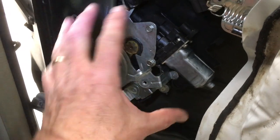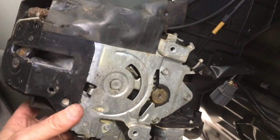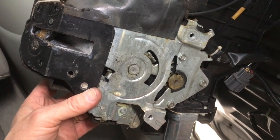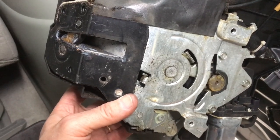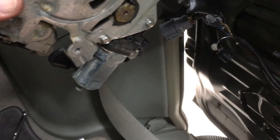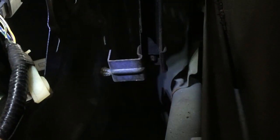I've been wrestling this a little bit. I rotated it counterclockwise and I believe that's what helped it come out. I finally have it out. Rotating it counterclockwise did help and also I had to maneuver it past a bracket for the back side of the window — the window track, where the window track mounts at the base. That is the window track bracket and I had to just move it around slightly to get this mechanism out.